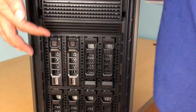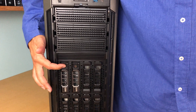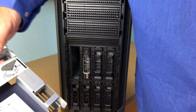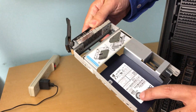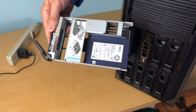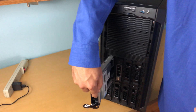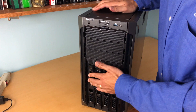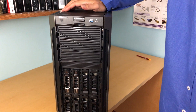There's also a base area where you could add things — originally you'd put a CD-ROM or DVD-ROM there. The drive bays in this case are for the larger three-and-a-half-inch drives, but I use SSDs as much as possible. They've got a nice little conversion bay that fits the smaller SSD into the larger bay. In this case I've got some 960 GB drives in here, and they're hot-swappable — you just slide them in.